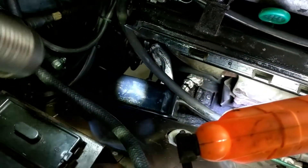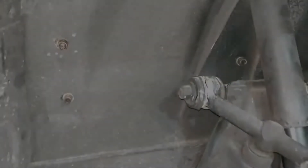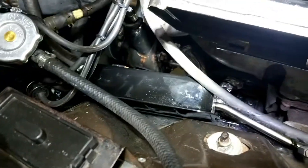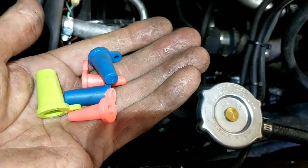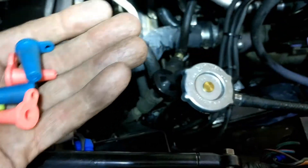I'm going to take the header tank off, I think. The wheel's off. These are the bolts — this is the front left wheel. I'm not sure what size they are. I tried loosening it and it actually made things not much better, if not worse. So I've decided to take these pipes off and just block them off at the end with these little bungs, and hopefully that'll do the job. Then I won't have to drain the coolant.